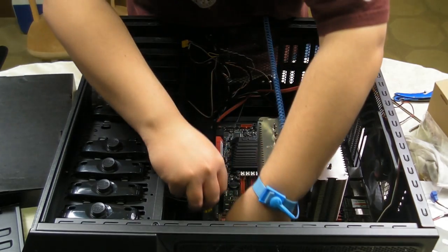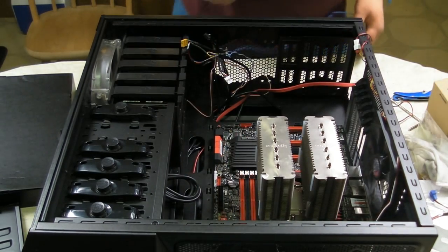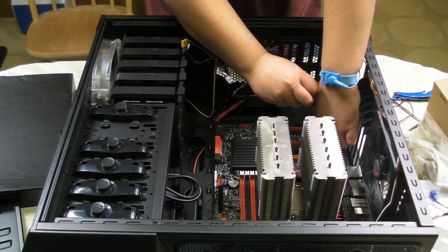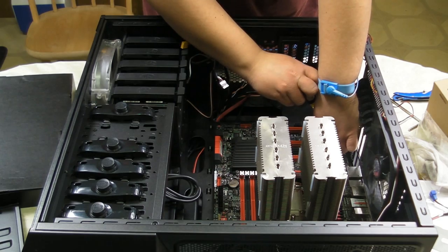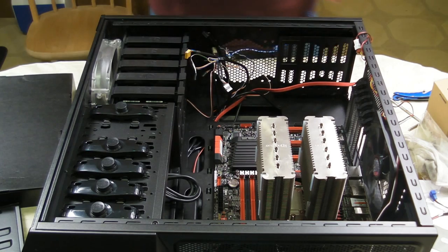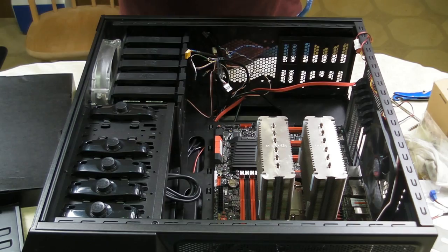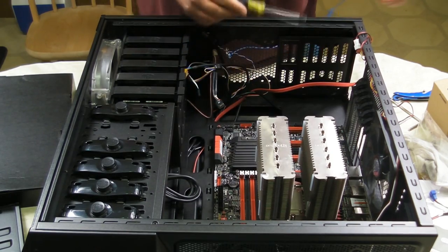Generally, I like to go for the easiest corner screws on one side, and then I go to the corner screw on the other side. And this basically ensures that it does not shift. And don't worry if you don't get the screw in the first time, because even an experienced technician has times where the screws fumble around. It just happens. That's why we have tweezers. I happen to use Hosan ESD safe tweezers. They work great, and because they're ESD safe, they do not transfer any electricity. So basically, we continue to screw in all the parts where we see standoffs.